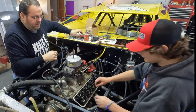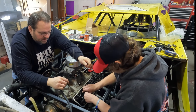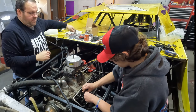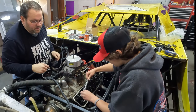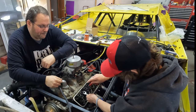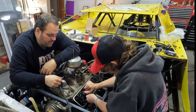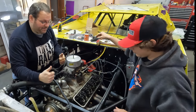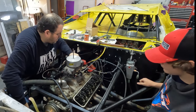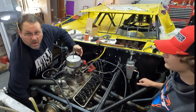Dylan, you do that one. You'll know it when you feel it — you'll hit a spot all at once. Right there. And then check your push rod too; you can tell. So you're at the spot. Put a quarter turn in. Lock it down. And that is that. Next up, we're going to rotate forward — what's our next number? Number eight. So we're going to rotate until our rotor goes to number eight, and we just rinse and repeat the entire process until the rotor goes all the way around and we are done.